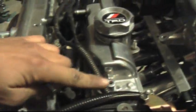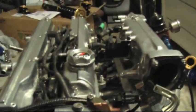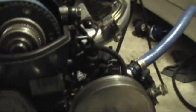On the top of the engine for the GTE there are ten bolts total to take off the spark plug cover. On the GE engine there will only be two bolts for the upper cover — that's the main difference for the two engines in terms of removing the upper cover. I'm going to go ahead and take off the last bolt here next to the pulley.